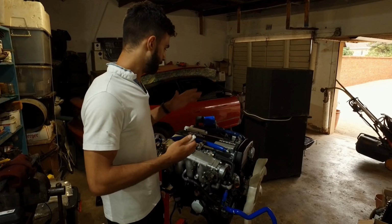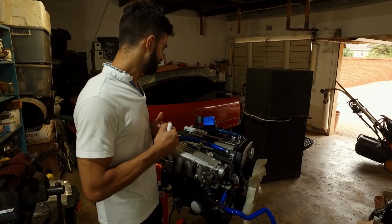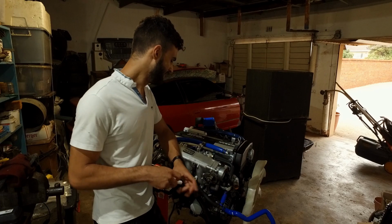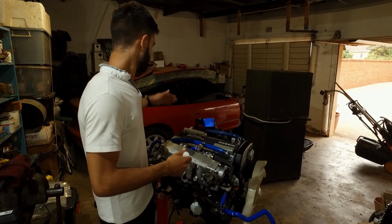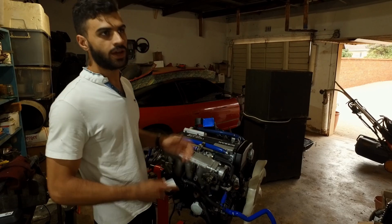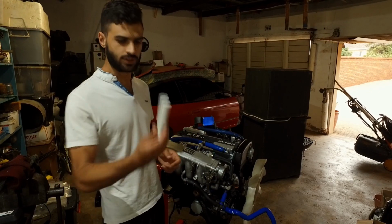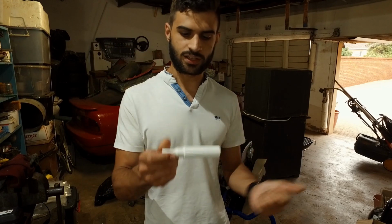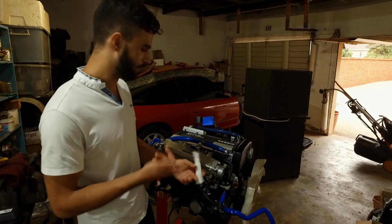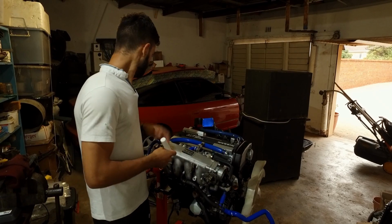So, as nervous as I am to try and get this stuff done, we just gotta kind of do it, right? I kind of been procrastinating because, yeah, people get nervous, bro. But so we're gonna pull this off of this. We're gonna hoist it up. We're gonna take it off the stand. We're gonna drop it down. We're gonna have to take the back plate off. Once we have the back plate off, we have to get the flywheel and clutch and everything mounted. So I went through and printed the S13 clutch alignment tool, which is pretty cool that this is just available online and I can just align my clutch. Never done this before. We'll figure out what we're supposed to do. But yeah, let's start off with that.